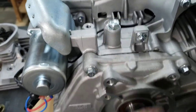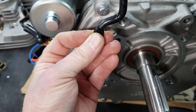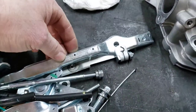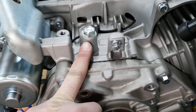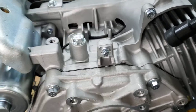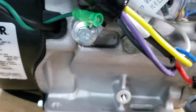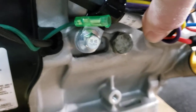There's a rod that comes up through here that runs against that nylon gear and up through here to actually regulate the throttle through these rod linkages. We don't need all that. I actually tapped that hole out for a 3/8 bolt, put some silicone on the bolt threads, and ran that thing down tight — so that's never going to be a problem again. I also took out the oil sensor and the wire for that, which came right through the side of the block. I tapped that out for a 1/2-13 bolt thread, siliconed the bolt and tightened it down, so that should never leak either.